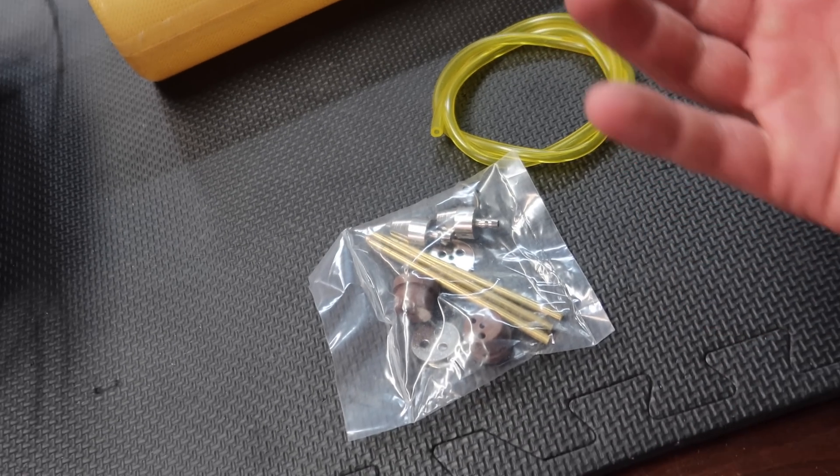Next thing is to put the fuel lines and vent line on the tanks before we put them in. Because these are smooth tubes with no barbs or nipples, you want to safety wire them. We'll put our tubes on the tank, then once installed we'll put the tank in the airframe and add a drop of either silicone or shoe goop on each tank to hold them in place. At that point the back half of the aircraft is done and we'll be ready to bolt on the nose.